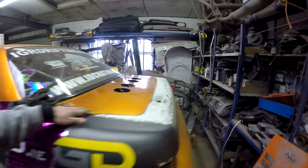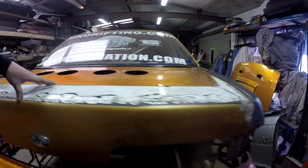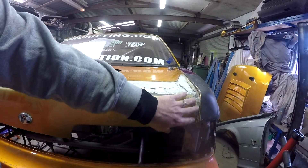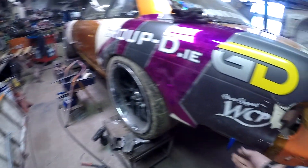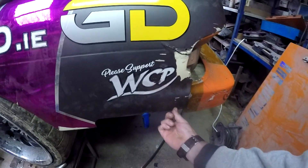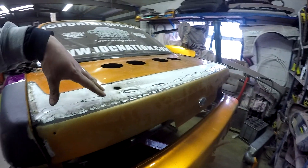I've got the boot just mounted up. I had to do a little bit of repairing on it — the wing was destroyed and all that corner — so I have it reasonably straightened out and a little bit of body filler should finish that off. In there I've mounted a support to catch the rear quarters so they're good and solid, and I just have a clamp for the moment. I'm going to have to put another couple of supports in there.